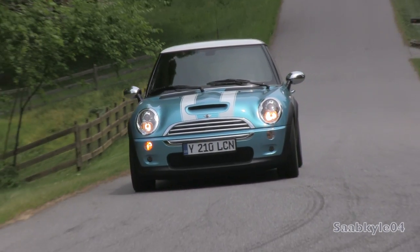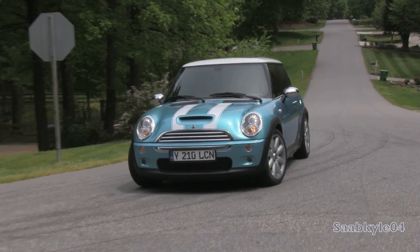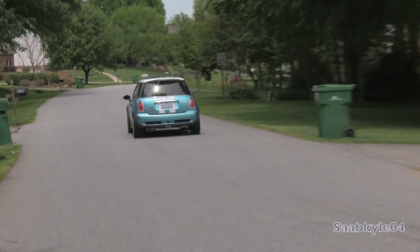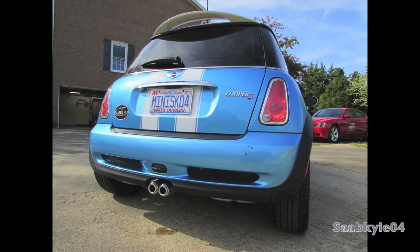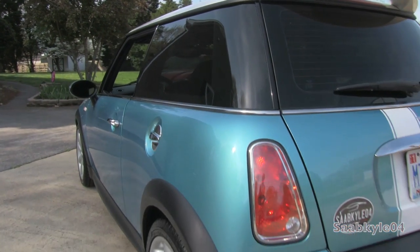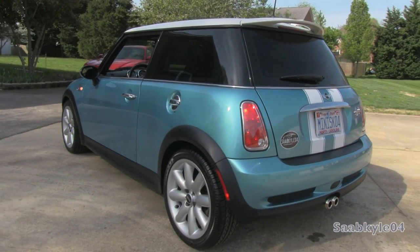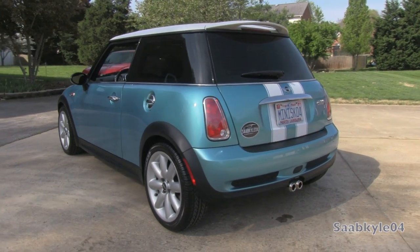It takes a force of 24,500 Nm of torque to flex the frame 1 degree. Thanks to the steel unibody, this means the Cooper is quite stiff. It makes for a great handling profile, but does sacrifice ride quality. It's quite stiff, but not punishing. Being that the Cooper is front-wheel drive, Mini engineered equal-length drive shafts in order to eliminate torque steer for both Cooper and Cooper S variants. It also uses a drive-by-wire throttle system to electronically transmit accelerator input for a faster, more consistent response on demand.